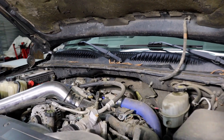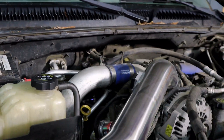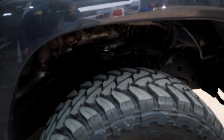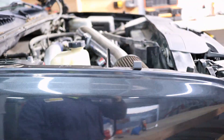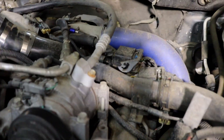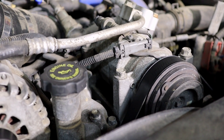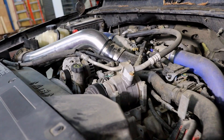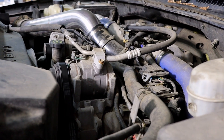The project begins. A little before video of what everything looks like. This is a 2003 Chevy 2500 HD with the 6.6 Duramax. It's got a leaking head gasket and we're gonna fix things up in here. We're gonna pull the engine out today and go through the whole thing. We're gonna replace lower end bearings, a whole upper gasket set, and we're gonna do ARP head studs.